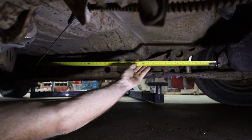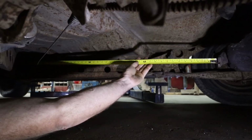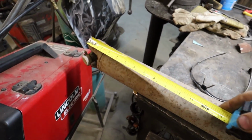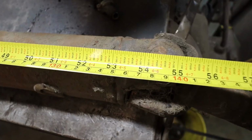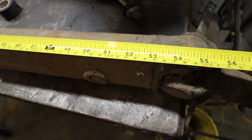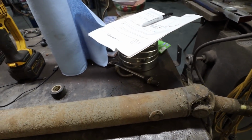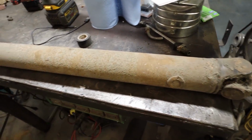Ouch. A flange. A 53. Let's see where our drive shaft is to that. Okay, a loose measurement to the bottom of this cap tells me I've got to take an inch out of this drive shaft. Kind of lame, eh? The bottom of there had to be 53. Which is fine, so I can pretty much just cut this, take my inch out, put on the proper end to fit on the transmission, and then we're kind of cherry. Our drive line is done.